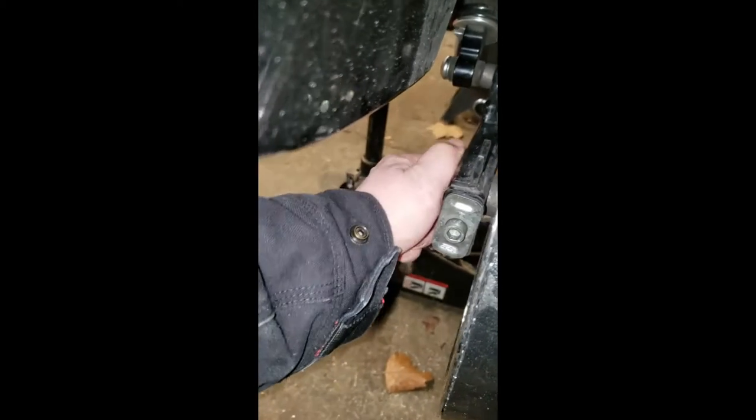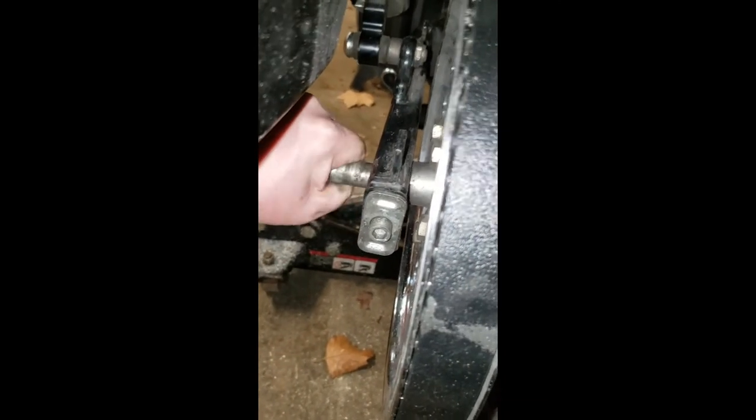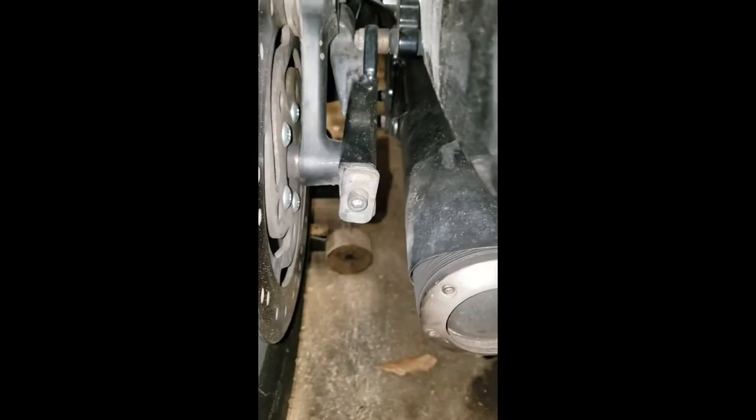And over here, you can grab this axle and hopefully pull it out of there. This might require more hands than I have cameras. I'm gonna take the wood end of a hammer here. From there, as you can see, start to pull it out. When we get to that point, we'll have to slide the brake caliper out of the way and keep track of all the washers down here. I'm gonna put the camera down and do this.